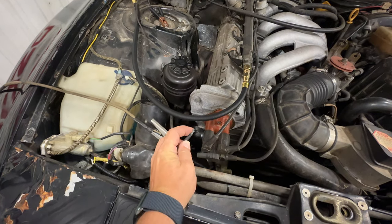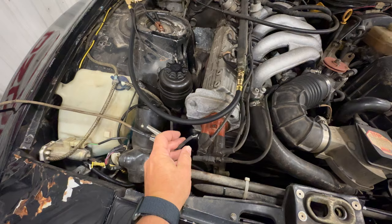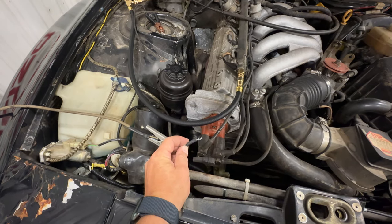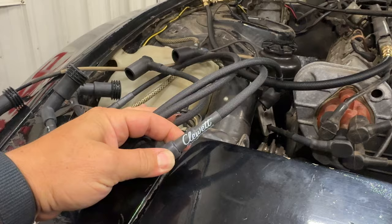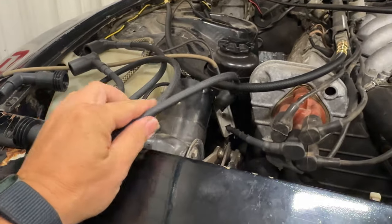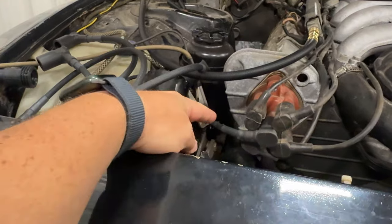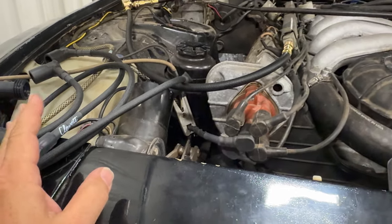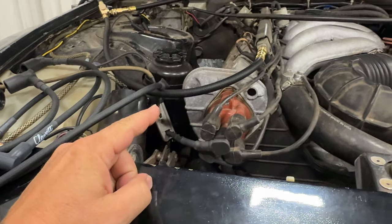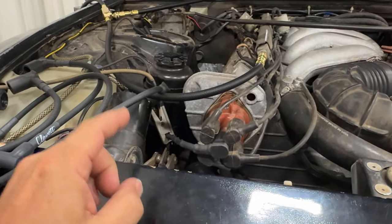But just like every other time, when I fix something, I think I've got it fixed and I'm not really sure. So I need to replace this wire and then we'll do the test anyway. I picked up some new ignition wires — these are from Clevett and they seem to be really high quality. I will replace all of them eventually, but for now I just put the coil wire back on. I also ordered a cap and rotor as well as spark plugs. I'll put those in later. Let's see if it runs okay now.